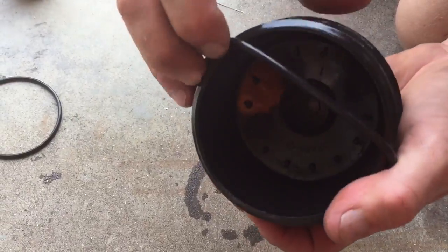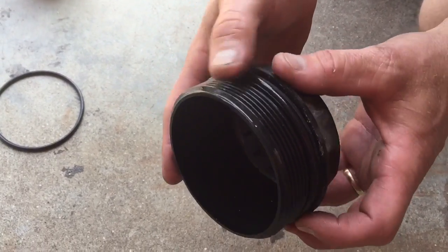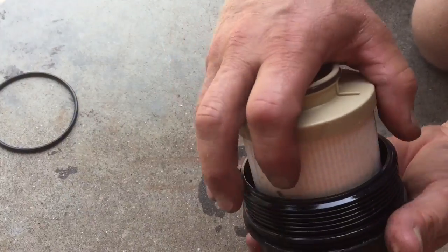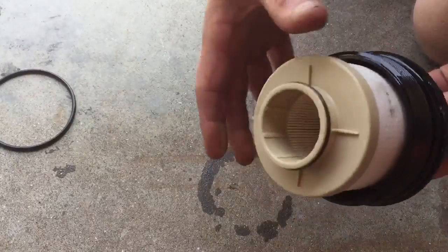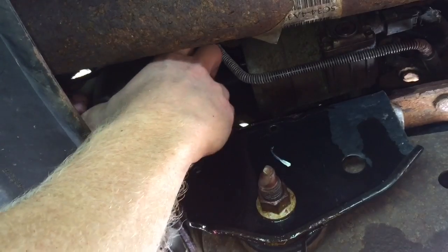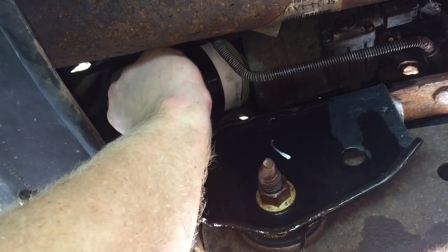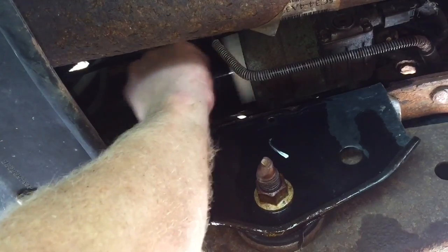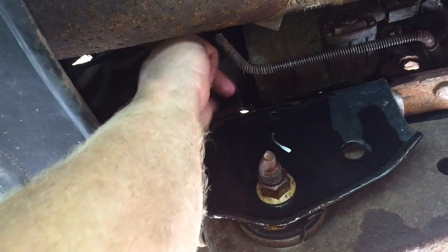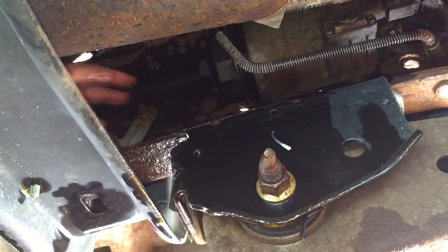It just goes around there — make sure that it sits in the grooves of the cap, all the way around. Now I can take my fuel filter and it should snap right into the cap, and it stays put like that. It makes it real nice and easy to put back in once I get back underneath the vehicle. So I take my cap with the filter on it and I slide it up and into the housing, and I want to make sure that I get this lined up and get it started by hand before I put any wrench or socket on the cap, that way I don't cross-thread anything.